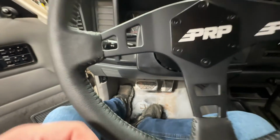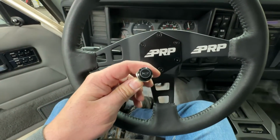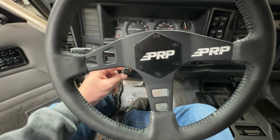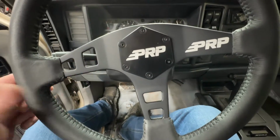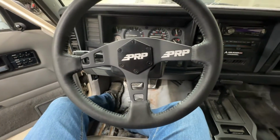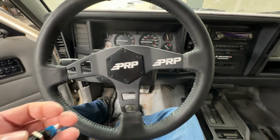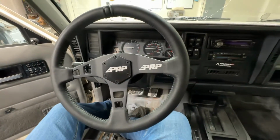I bought a flush mount horn button off Amazon. I'll put a link down in the description for this, but it should look pretty nice, like just right here in this area. And it's pretty easy to get to with your thumb while you're driving. So that's what I'm going to do. We'll get this all wired up. It should be pretty straightforward. I just need the power wire that's underneath the cover here and then to ground it. And then the switch will ground the circuit for the horn to work. Anyways, let's get to wiring this up.